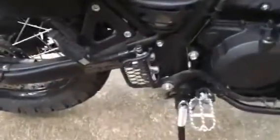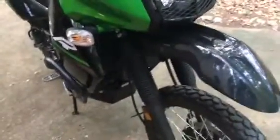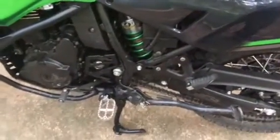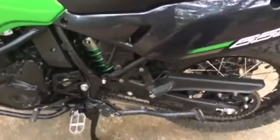I've gone ahead and added a protector here for the brake master cylinder, as well as a rock guard up in the front because I spend some time following my friends around and they're throwing up rocks. Shortly, I'll have a new brace coming across for the front fork brace as well, and because I've installed the center stand and this is all plastic back in here, it's a little more difficult to raise it, particularly if you put panniers or something on it. So I've got a handle coming in for right down here that we'll be installing this week from Happy Trails.